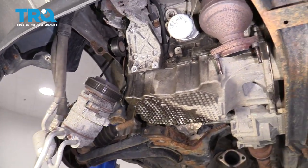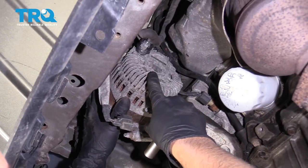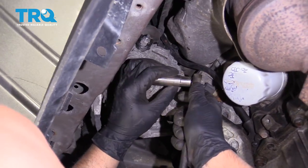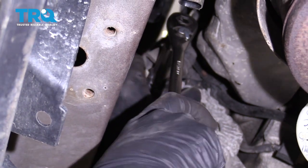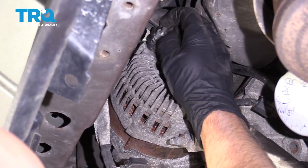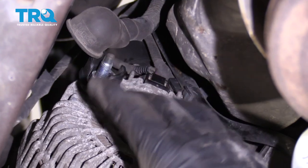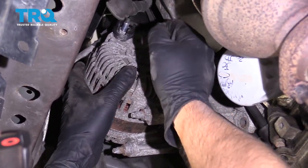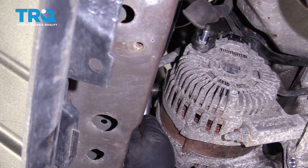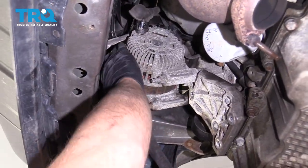You may not have to take the alternator out to access the bolts, but it's gonna be easier. We already disconnected the battery, so we'll just take the alternator out. Use a 13-millimeter socket, take this nut off, and disconnect the cable. This connector is a little tricky, so take the bolts out first, lower it down a little, and then disconnect it. Use a 15-millimeter socket and take the bolt out up top first, then slide that bolt out.